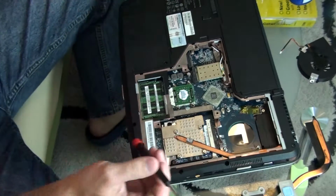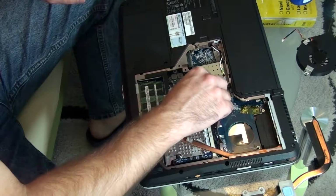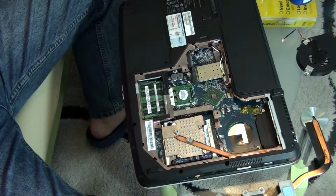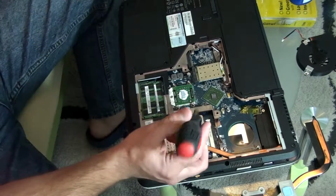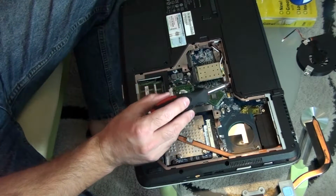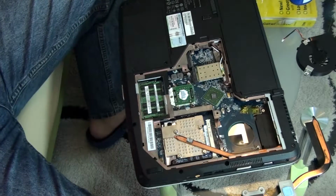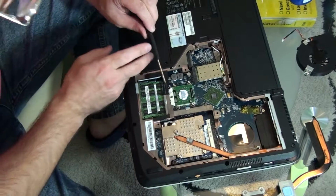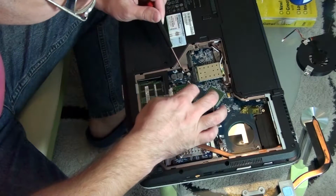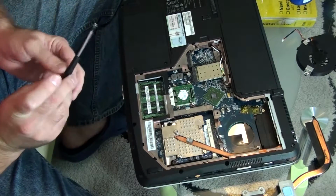So basically what you do, you have to dismantle your lappy as I did. Remove that foil. And heat it up, this area, with hot air gun. I already did it. As you can see, there is slightly overheated area, which I don't mind. I never looked at this thing twice. Little bit of thermopaste will help. So basically, again, you have to heat up this chipset.